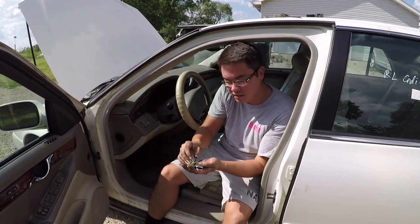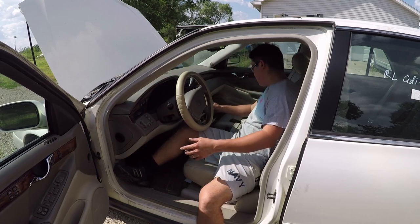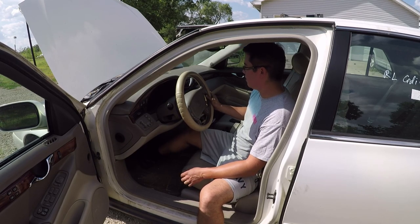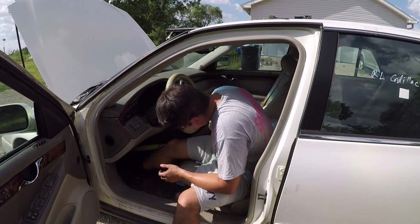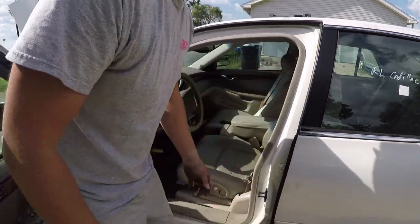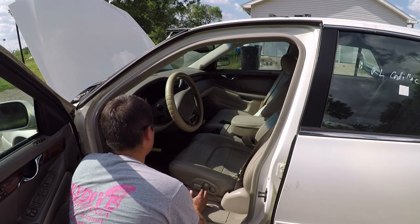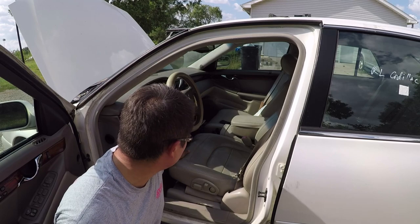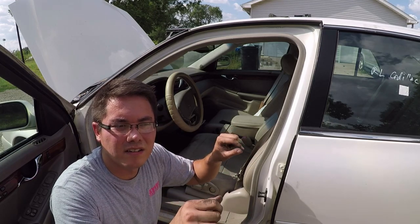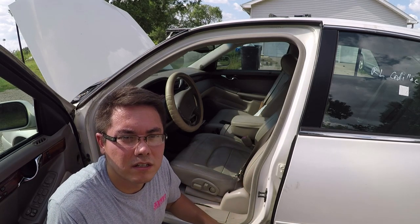We're back — I got the car keys, I'm gonna start it up and see how the brake pedal feels, then I'm gonna show you how to bleed this thing. I have the brake all the way to the floor and a baseball bat is holding it against the seat. What I'm gonna do is go loosen those two brake line bolts — that's gonna release the pressure — then I'm gonna shut them and refill the master cylinder if needed.